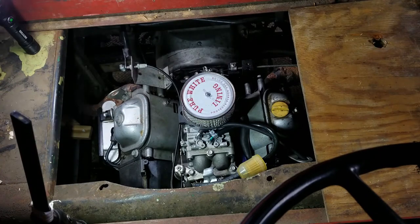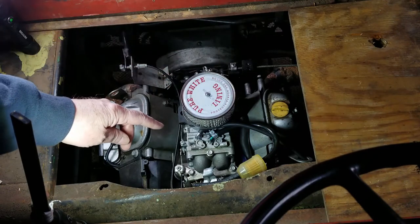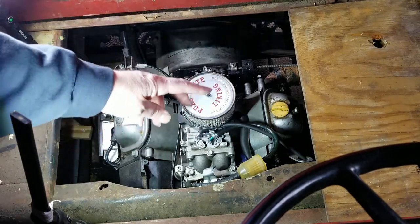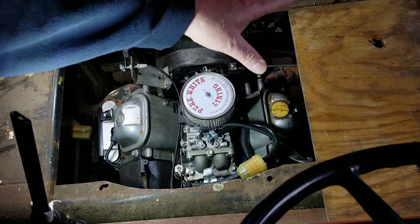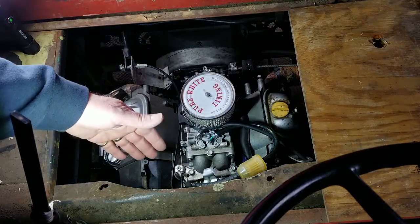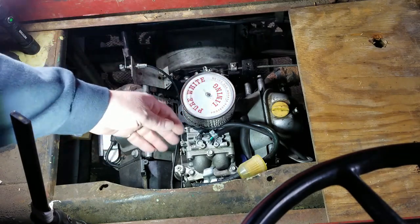This is the first issue. What everybody does is a couple of things when they're messing about — they take the exhausts off, put straights on it, they'll put electric fuel pumps on them, they'll change the stock pulse pump, or they'll make some terrifying mistakes like I did in the first place, which was to put an electric fuel pump from a dirty fuel source. A filtered electric pump, and I didn't bypass the diaphragm pump. Even a 2.5 to 4 pound fuel pump will eventually mess up the diaphragm pump.